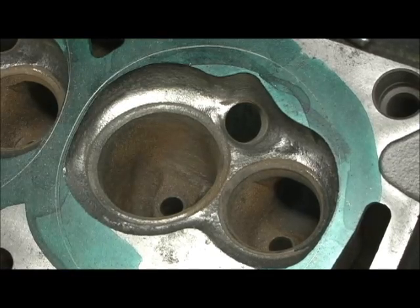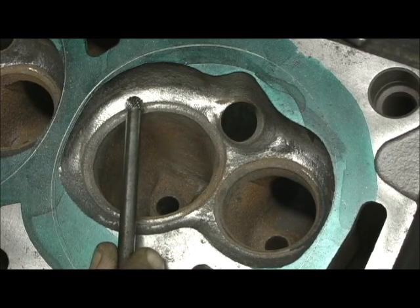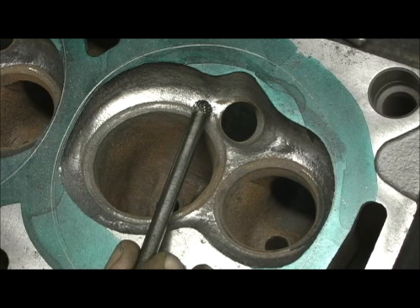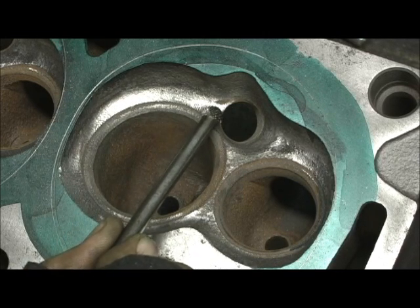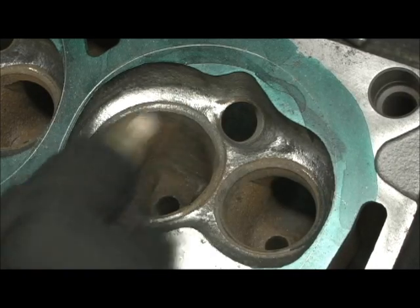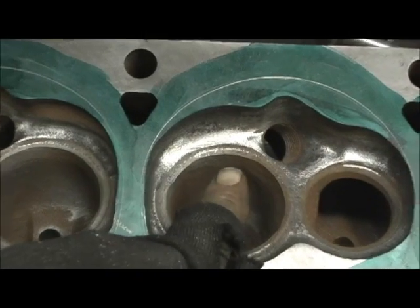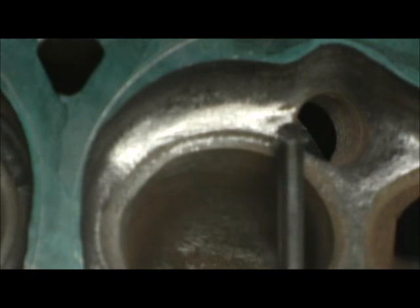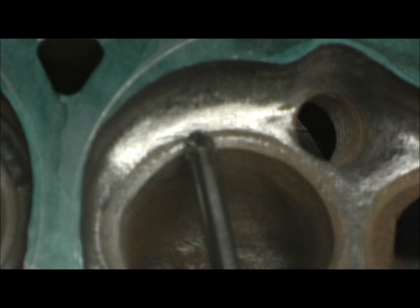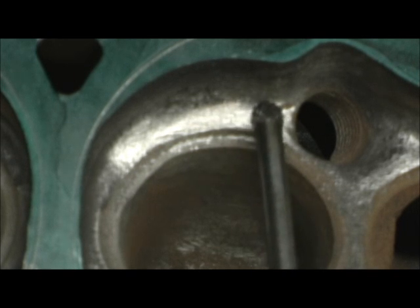Notice how I use the larger ball in this area, then I remove the valve and come in here and touch — and man, you've got to be careful right here, this is critical. I've pulled it down to where you see a little thin line of the factory cast — that's going to be your template. So as you're coming across right here and pulling this in, that's the image you want. You can't have the valve in the head — there's only so much it will let you do. Right now at this point I've got ten and a half hours on the combustion chambers and I probably got ten to twelve more to go.